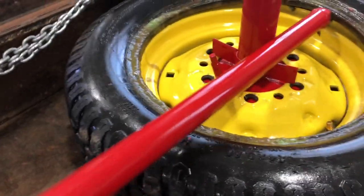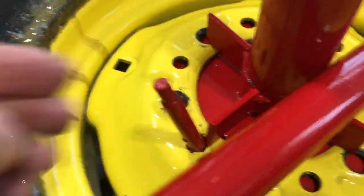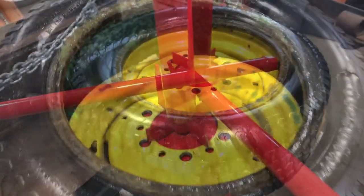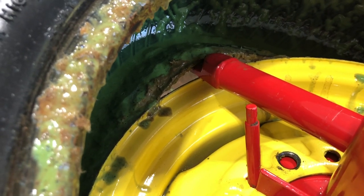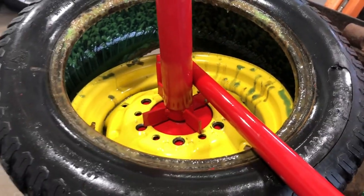When you go around you can lift it up on an angle so you go over the stud that's holding the rim on the machine itself. We've already done that so it's already off — that's as simple as it is. Same thing on the other side of the tire: pull the tire up, get the flat side of the tire iron and put it underneath the tire in between the rim, and go around once. Once I do that the entire tire will come off the rim.